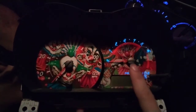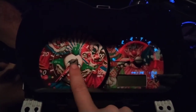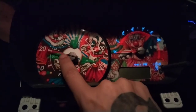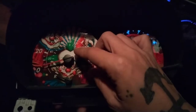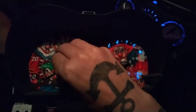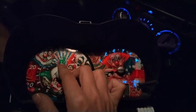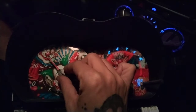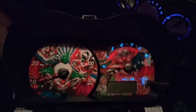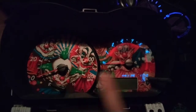I have everything installed and put my needles back. You can see that the cluster shows light through. The gas needle is resting where it's supposed to rest. I left this one to show how to recalibrate — it's not sitting correctly; the speed needle is almost touching the gas needle. If that happens, take the needle back off, bring it and place it back in around the 80, and you'll feel it — it'll be really loose. Once you feel it slow down and start to grab, bring it back down slowly until you reach the correct line. That's where it comes in handy if you took a picture at the beginning, because you'll know exactly where each needle rested.